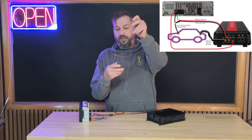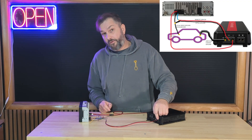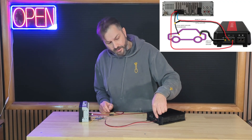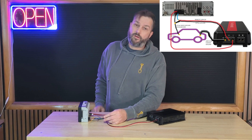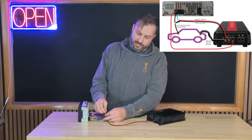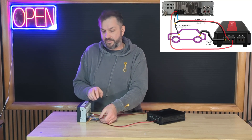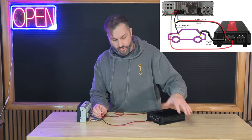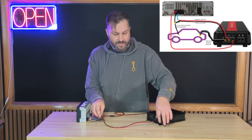Here's the important part: that second conductor - the heavy gauge black wire - you're going to connect that to the ground terminal of your amplifier. You're still going to hook up the ground terminal to a local ground, something heavy gauge that can handle the amount of power this thing's drawing. But you're also going to take your 12 or 14 gauge speaker wire ground and run that up and tie it into the ground wire of your head unit. This is still going to get a local ground - it still connects to whatever local ground you would have connected it to anyway. You're just introducing this one additional wire. So you've got a three-way connection: the local heavy gauge ground to power the amplifier, the local ground for the remote turn-on, and this additional shared ground.